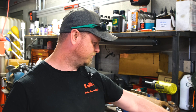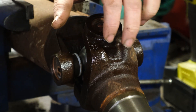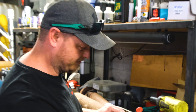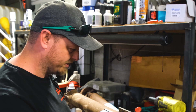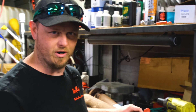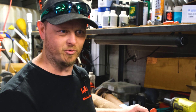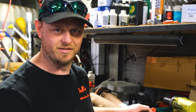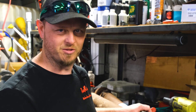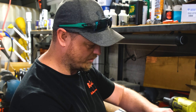Today we're doing U-joints. A lot of questions are asked on how to get the stubborn stiffness out of the U-joints as you put them together. We can see here how this one moves nice and easy freely, but this one here is super tight and stubborn. Got the new U-joint in there — that is not okay. A lot of people leave it like that and then wonder why you get a growling noise going down the road, maybe the same growling noise before the U-joint was replaced. In all actuality, this bearing inside this U-joint here is bound up.